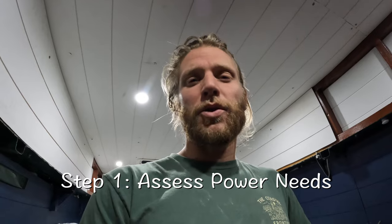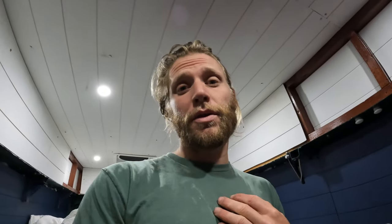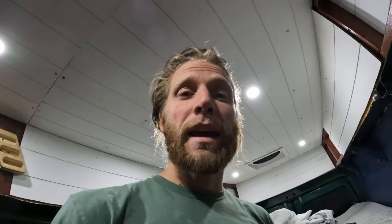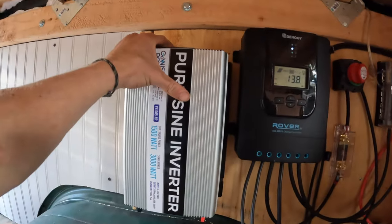Hopefully, you can learn from me and not make the same mistakes I did. Before you get bogged down in all of this, you need to do two things. First, get an understanding of how much solar power you actually need — I've put a good link below. I chose 400 watts of solar, a 300 amp hour lithium iron phosphate battery, a 40 amp charge controller, and a 1500 watt inverter.